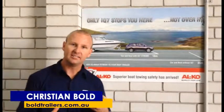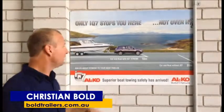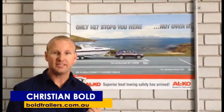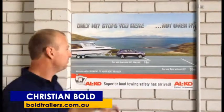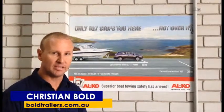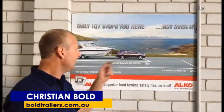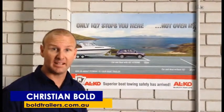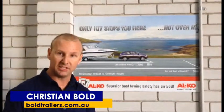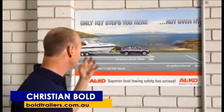Now how it works is it's electric, and it's also air, and it's also hydraulic. What you've got is your electrical feed that comes through the car into the unit. It then works a compressor which builds up the air, which pushes the hydraulic fluid through to the brake calipers. Now what happens if your car was to detach itself from this trailer and the electrical plug was to come out from the car, the brakes would lock on automatically. And that would stay on for at least 15 minutes, because the air built up in the compressor is what's pushing the hydraulic fluid onto the calipers and making the brakes stay on.